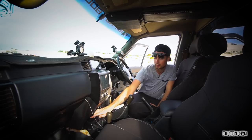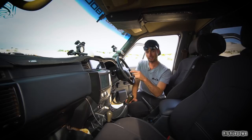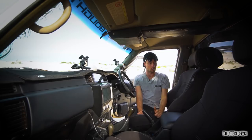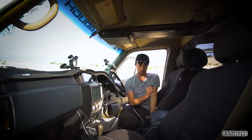There's an inside controller so I can hook the winch up and control it from in here. There's a button for connecting the batteries together for a jump start, and I've also got manual control of the thermo fans. This is a three-way switch: one lets it be controlled by the ECU, the middle slot turns it off for water crossings, and the bottom one keeps it turned on for when you're ripping through the dunes to keep the thing cool. I've also made a roof console with a whole lot of switches for the lights and lockers — it's got front and rear lockers. All the electrics are on the backboard here, basically all the fuses for the accessories running off ignition and auxiliary control, as well as the relays.